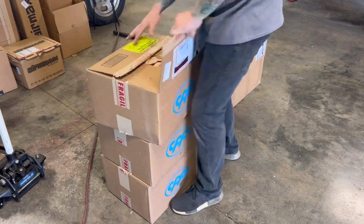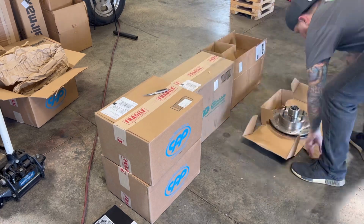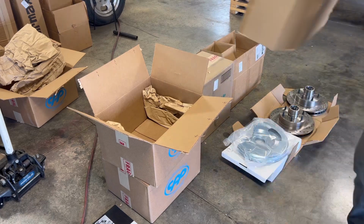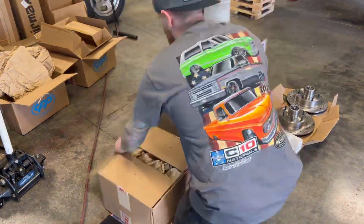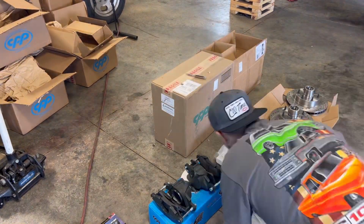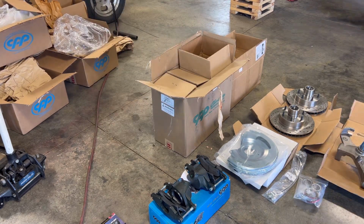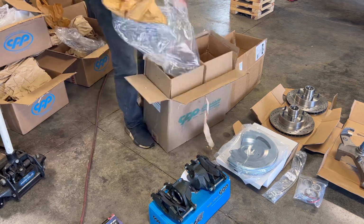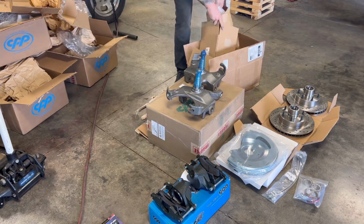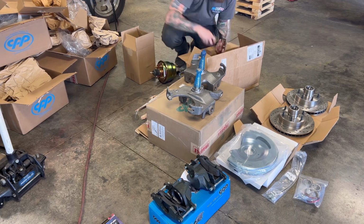Okay, so we got our lower control arms bolted up, and now it's time to install our 2.5-inch drop spindles and our disc brakes. So I'm just kind of showing you what all is in this kit that we purchased. This is from eBay. It's a CPP kit. I've got the link in the description. As I unbox this, you can see you've got the rotors, the dust covers, the disc brakes themselves. I'm unboxing the 2.5-inch drop spindles right now, and also the master cylinder, and it's all included in the kit. The only thing that's not included is your brake lines. You'll need to order some of those if you need all new brake lines.